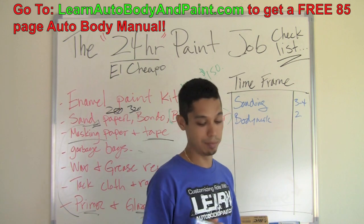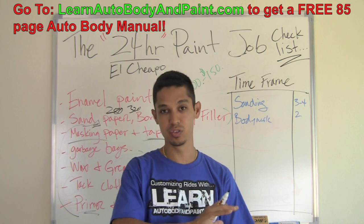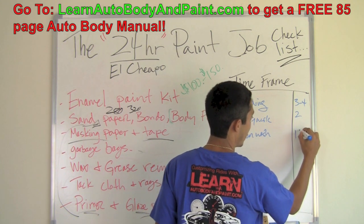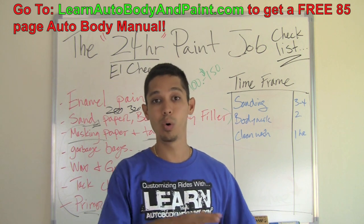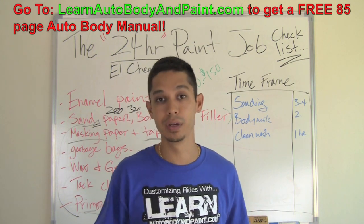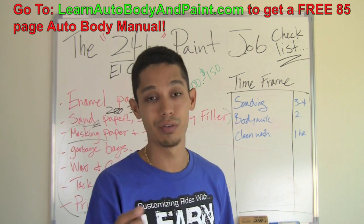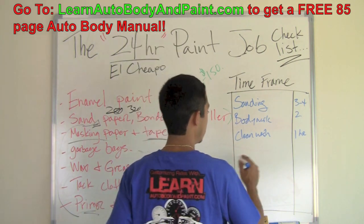Then wash the car down, blow it off. I really recommend washing it — it's good if it's a nice sunny day. Wash the car, make sure it's all clean, take all that dust off, and let it sit in the sun for about an hour. After it's sitting in the sun, bring it back into the shop or garage and go over the whole car with an air chuck from your air compressor, blowing out all the seams. You're going to see some dust fly out and maybe a little water — the worst thing is when a bead of water comes out of a seam while you're painting. If that happens, you've got to dab it out with a rag and try to bury it with your paint.